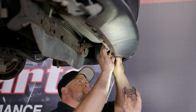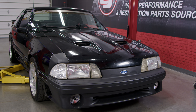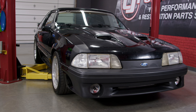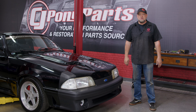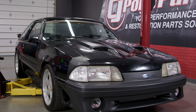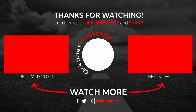To reinstall the fender-to-bumper brackets, tighten them down. Go behind the fender and tighten all the studs coming through from the bumper to the fender. Install some push pins on the bottom. I used this bumper cover on my 93 Cobra and was happy with the fitment, and I'm happy with it on this car too. I know the front end's probably not exactly straight and that fender's got some issues, but overall the bumper cover fits well and looks way better than the one that was on here. Give yourself two to three hours and you'll be back on the road in no time.